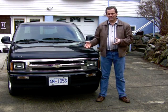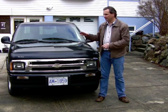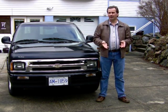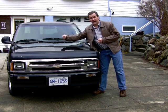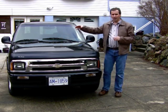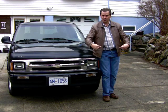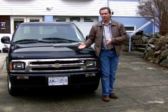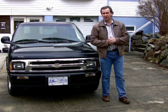If you can't find a car mechanic, you could probably find an electrician because they could do it too. Nearly any car can be converted — some are easier than others. Most people convert a pickup truck because it's easy to find a spot for the batteries in the big space in the back. If it's rear-wheel drive it's a little easier, because the motor I put in under here spins the same way and hooks up to the transmission to drive the rear wheels. With a front-wheel drive car, the engine is sideways and you need two motors to convert it — it's just a little more complicated, but they can be converted too.